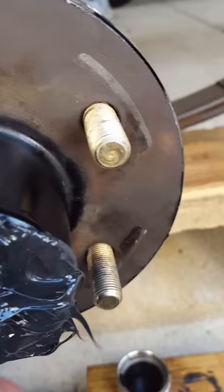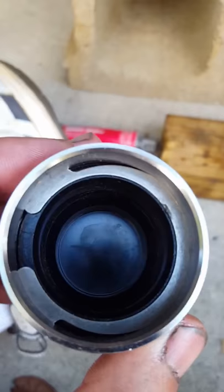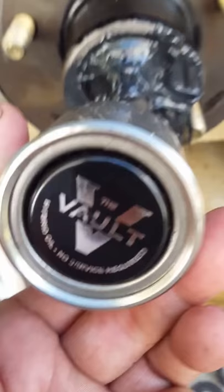Here's what you end up with: once you stick your washer and put your outer bearing in, grease will come out like this. Then put your washer in — this is what you're going to see. You want to keep as much of this grease level out here as you can possibly keep, because you're eventually going to fill up this cap. The snap ring up here is going to be filled; you'll put this in there and drive it in, and when you do that, the black center hub bolt area will pop out — that'll tell you it's pressurized and all your seals are installed properly.